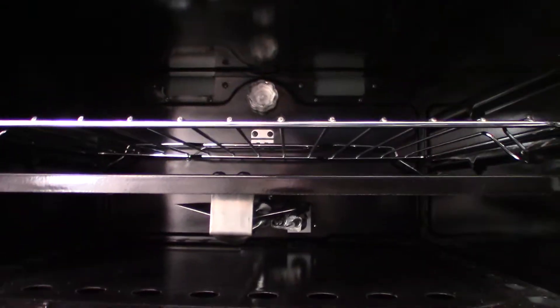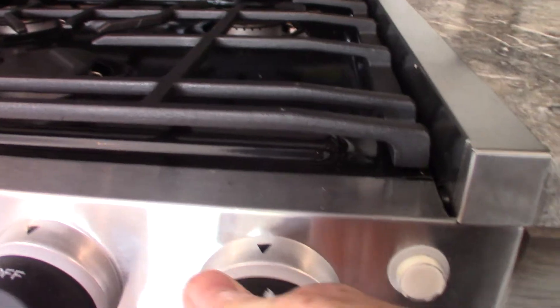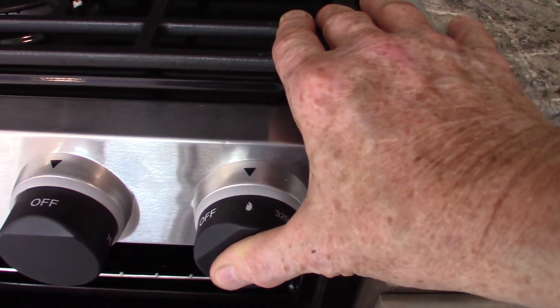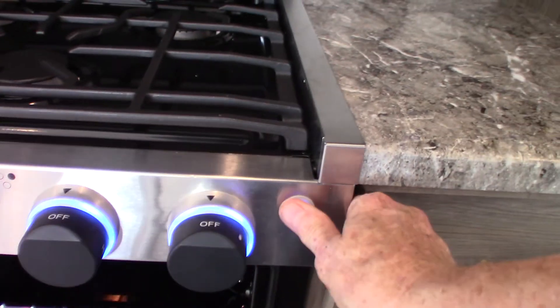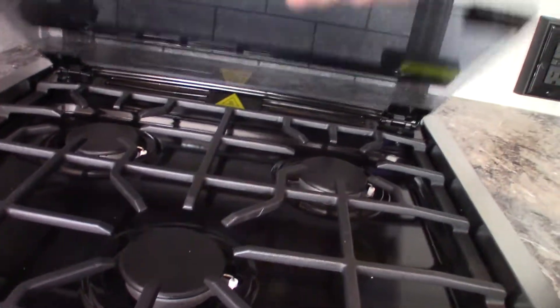The oven is a little different — at the very bottom in the back is a pilot light. You go to the picture of the flame (which means pilot light) and you depress it, keeping it depressed during the whole lighting procedure. Then you spark it with the other hand — make sure you do that clockwise. After the pilot light lights, hold the knob in for another 10–15 seconds until it heats up, then go to operating temperature. When you shut it off the pilot light goes out too, so you have to relight it each time you use the oven. Always keep this in the closed position when traveling so it doesn't break.